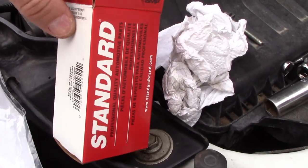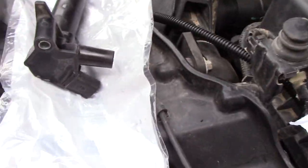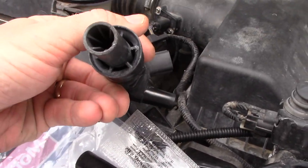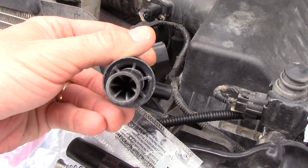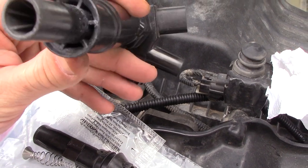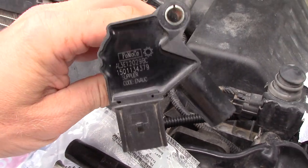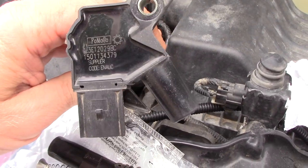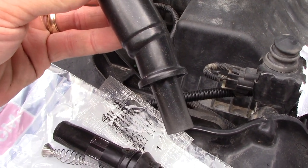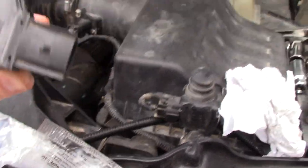We're back with the boot, and I was able to get the corrosion pretty much cleaned up out of here. The fact that two of these have done this is telling me it's about time to replace all of them. I'm starting to think that maybe these coils were the originals from the truck, and when they got the new engine they swapped these coils over — which would make them having about 180,000 miles on them versus 50.